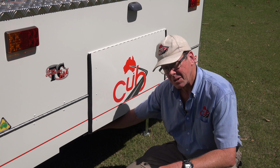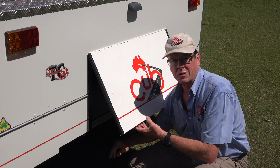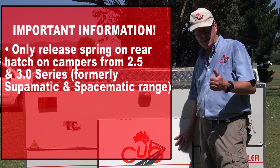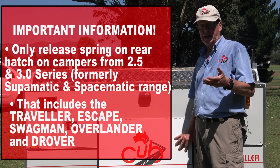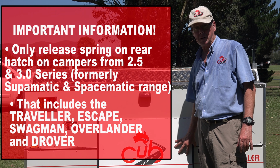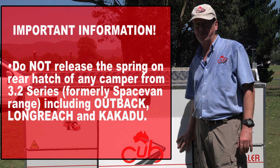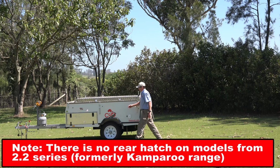On the rear hatch, simply grab the spring, pull it off the catch and release it. This opens the rear hatch. It is important on the 2.5 and 3.0 series campers, that is the Traveller, the Escape, the Swagman, the Overlander and the Drover, to release the springs on the rear hatch before you open the camper up. On the 3.2 series, that is the Outback, Longreach and Kakadu, it's important to leave the springs attached. Then we undo the latches all the way around.